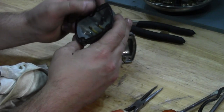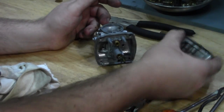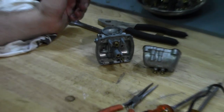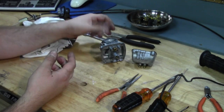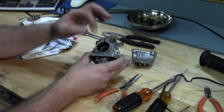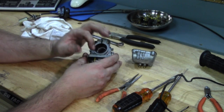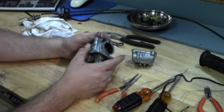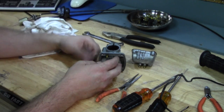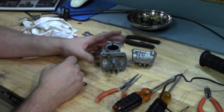Same with cleaning out the carburetor bowl — be careful of your gasket because you could reuse it if it's hard to find. All we've got to do now is take our parts and carburetor body and clean it all up. I will not soak this carburetor body because it's Bakelite — an early form of plastic that can disintegrate in some carburetor cleaners. So we're going to have to hand clean this. All the other parts we can put in a tray of carb dip and let them soak, then put it back together and set it up to factory specs using the service manual.